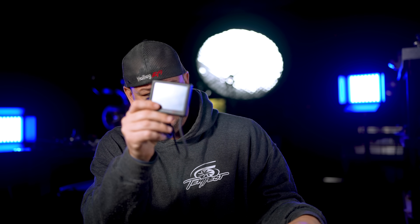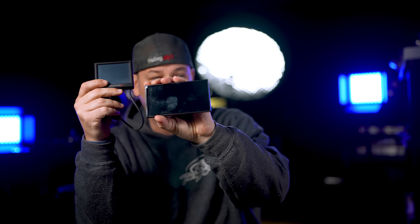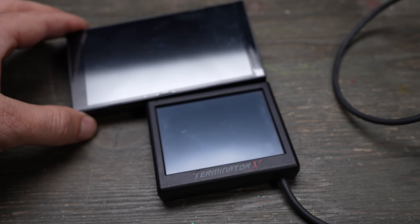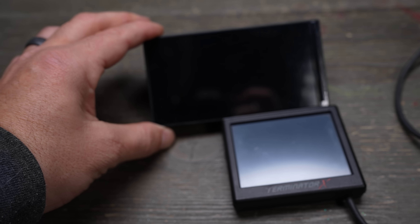Here is the big giant Monkey Fab Holley wiring diagram — I think I just broke my ankle. Next up: if you're using the older 3.5-inch touchscreen, Holley has the new 5-inch version which is just way newer and nicer. It has all the same functionality as the 3.5-inch screen — you can data log with it — but the updated gauges look way nicer and the touchscreen is way more responsive. These are about $400, but you can sell the old one for a couple hundred bucks, making this effectively $150–$250. Far cheaper than a Pro Dash, but significantly nicer than the old screen.